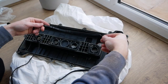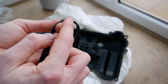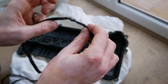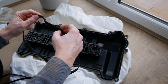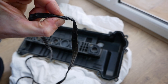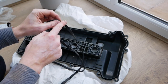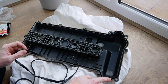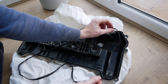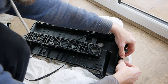Now this one looks like a massive piece of spaghetti. But you've got these little grooves, and you can see the eyelet on the rocker cover would be going there. So here's the outside and here's the inside. What you've got to find — I've just found it — are these thick areas on the gasket; there should be two of these, and these will be going where the sealant went. There's one there, and then there's one there. So I know that's going to go in there, and then just start feeding it all the way around.